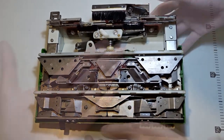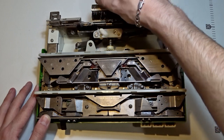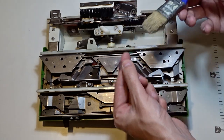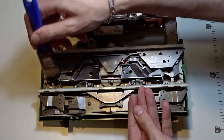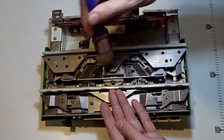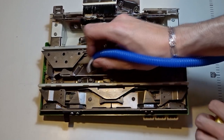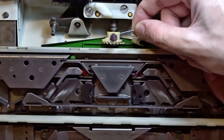Now let's clean the locks. This is the back lock. First take a sewing pin and clean the brushes — often yarn fibers are wound on the bristles. Now take the brush and remove all the lint. Use an inflatable pump: the air will remove the lint from places where the brush can't reach. I even found a small ball of yarn inside.